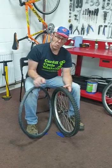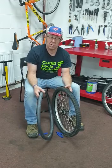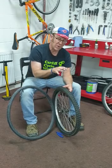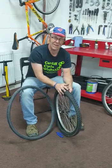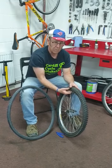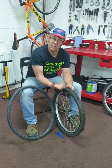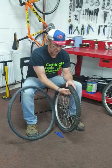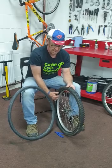Okay, so we've taken that out. If we're putting a new inner tube in because you've had a puncture, or maybe you've repaired the puncture, we want to make sure that whatever caused the puncture is not still in the tyre. So very carefully, we're going to feel around the tyre. We don't want to do this very quickly, because if there is a piece of glass or a thorn, we're going to cut our fingers. So very gently feel around the tyre.